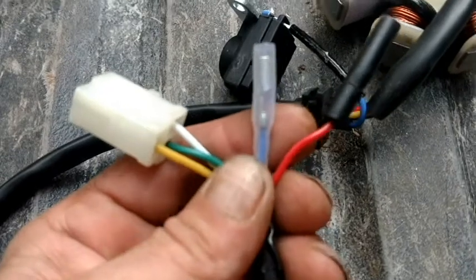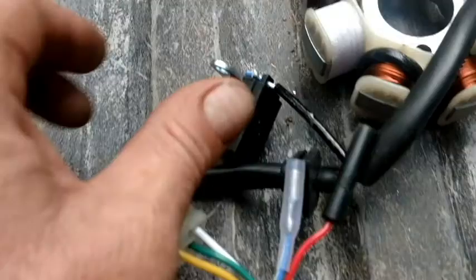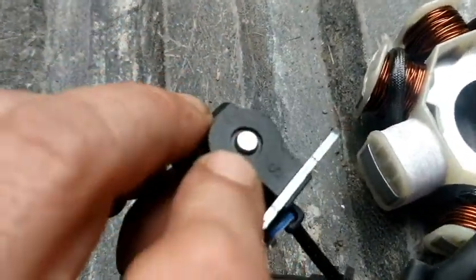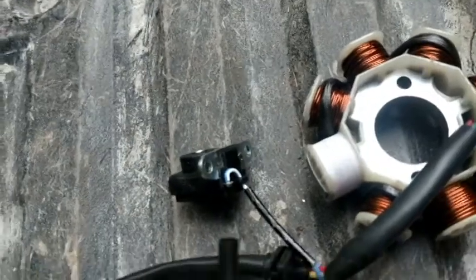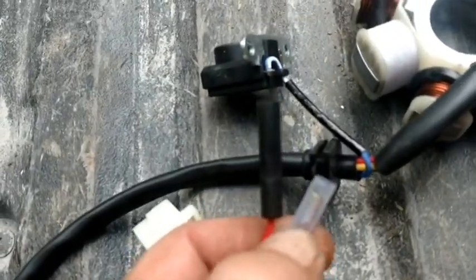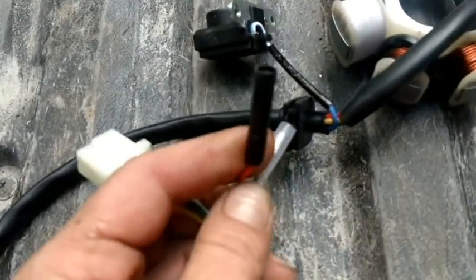The blue and white will put off anywhere between 0 and 5 volts and it will flash because it is pulsing. The magneto goes past this, which is called the pickup coil, and you should have 0 to 5 volts on that.